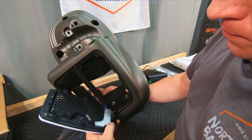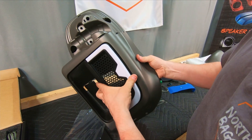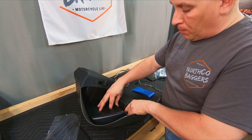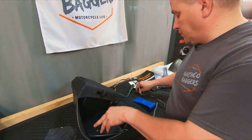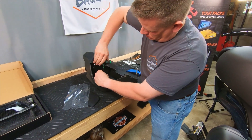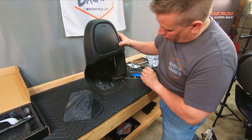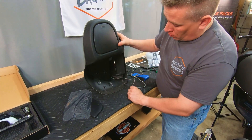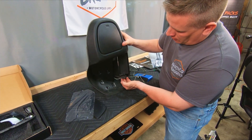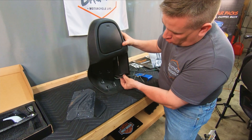Once you've got your wires through, simply go ahead and slide those into the slot. You can fold it right over and click it in. Once you have your wire through, go ahead and insert the back panel back on and tighten down your bolts. Once you have your back panel on, bring your wire across to where it meets your front frame rail to run up. There are slots on this support post — put a mini zip tie on each side to hold it nice and steady.